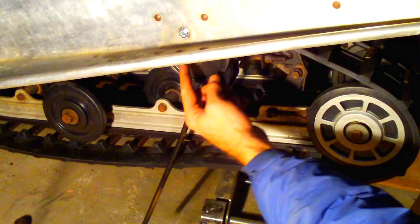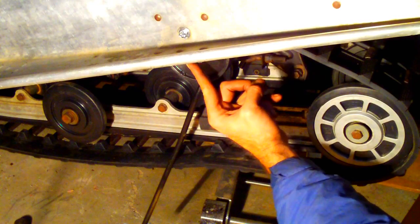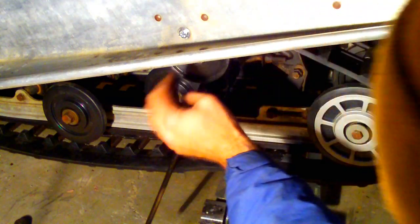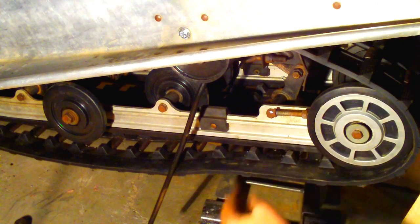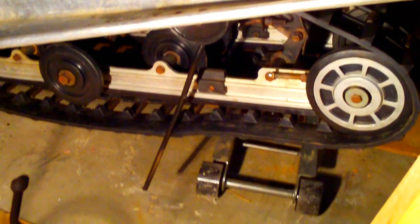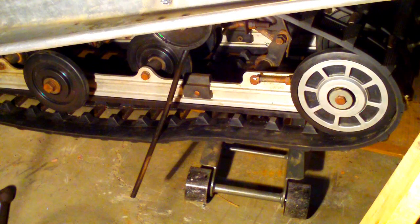Maybe it's because I'm using the lower mounting hole instead of the upper mounting hole, but it was a bear to get the suspension back in. What I found is taking these torsion rods and bringing them out of the cradle, folding them down — you can use these to move that axle shaft around up here to line it up with the hole on both sides. All the bolts are in, just a matter of tightening them up now. Then tensioning the track, because it's obviously going to be way too loose. I had to loosen the bolt all the way so the rear axle could come all the way forward to give me as much slack as I could get. I've also got a car jack underneath the track — I used that to lift it up, made things a lot easier. Got to tension and align the track pretty soon.